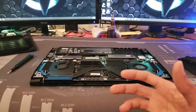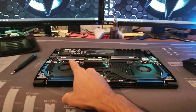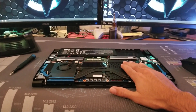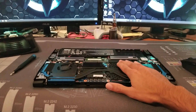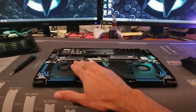So as you saw from that clip, I was having trouble booting into the operating system. It was trying to pull an OS off of the empty NVMe drive I had in slot 0, because the factory ships the 256-gigabyte (or whatever size) M.2 drive installed in slot 1 — and slot 0 is drive zero in boot order. So you need to swap them over.